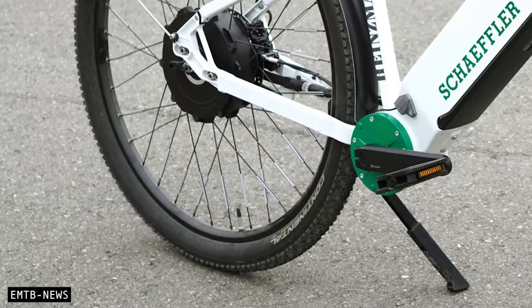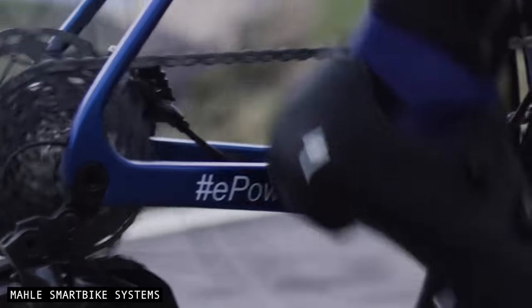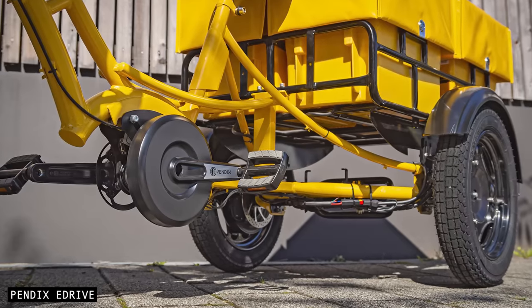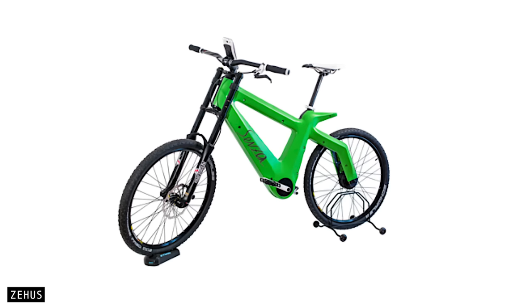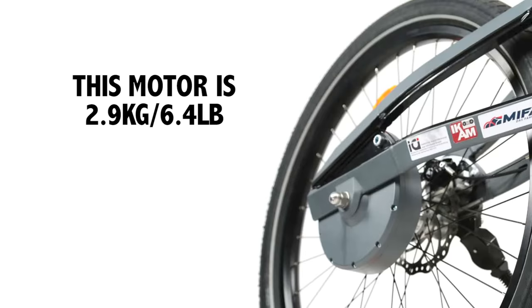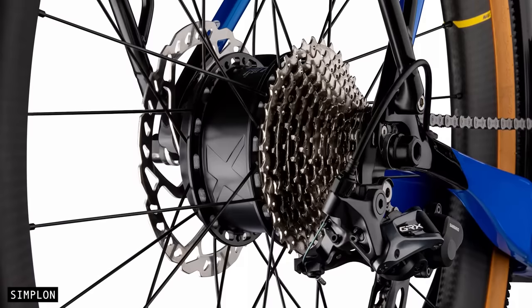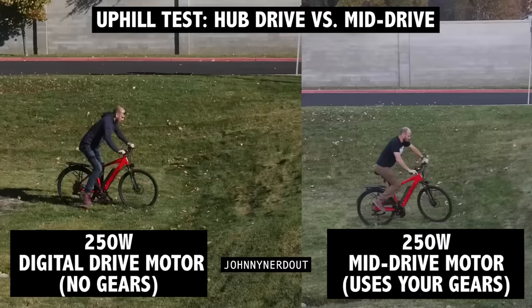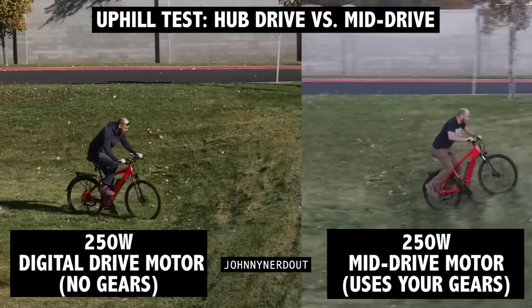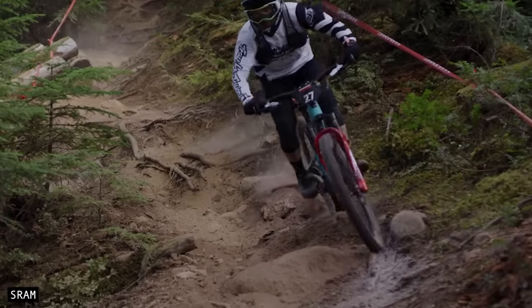Digital drive would also add at least 25% more weight to a bike. The lightest rear hub motor is more than one kilogram heavier than a regular hub, plus you can add at least another kilogram for the front generator and wiring. And given there is no mechanical coupling between the pedals and rear wheel, a digital drive motor needs to be especially powerful to make up for it — an appropriately powerful motor could be 2.5 to 3 kilograms. All rear hub motors cannot take advantage of your bike's gears to operate in their optimal RPM range for both steep uphills and flat riding. Unless you use very large and heavy motors, digital drive can only really be geared for one or the other. Combining this with the high motor weight, it's also less ideal for a mountain bike application.